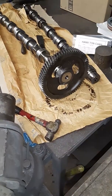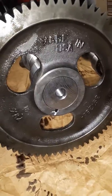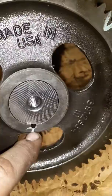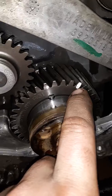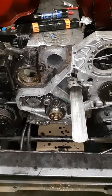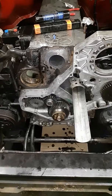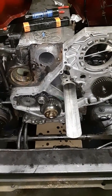That's what it looks like when you get the old cam gear pressed onto your new cam. Got your keyway lined up there, and then your mark right here on the cam lines up with your mark right here on your crank when you put that back in. Slide it all in and that way everything's lined up and you're good to go. Make sure you put some assembly lube on there, slide it on in, line up your marks, and you're ready to bolt everything back together.